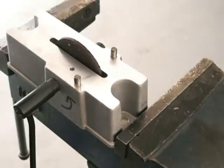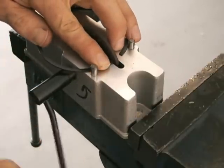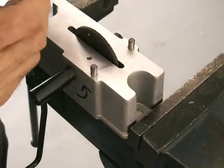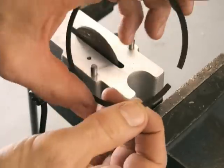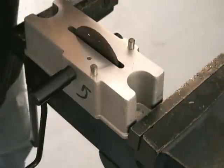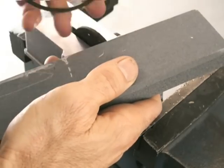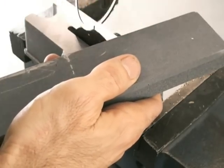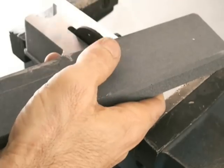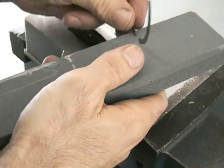To do that, we go to the ring filer. You'll see I always do this anti-clockwise, and I just file one side and leave the other as a datum. If you try to do both sides at the same time, I don't think it turns out as well. You also want to file the burr off — I'm just using a fine grinding stone; you could use a file — but you do want to make sure you get those burrs off so it's nice and clean.